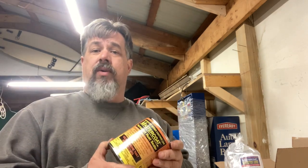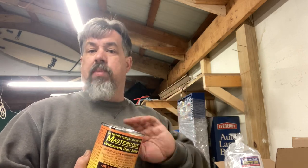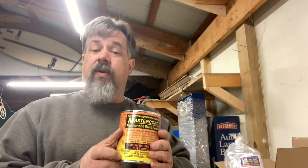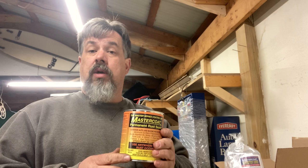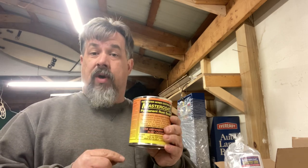This product is for rusty metal — after you've done a repair, this is a great product to stop rust. A lot of guys use POR-15, but this stuff blows that out of the water. POR-15 does not have any UV protection, so if you put POR-15 on and leave it outside it'll get chalky in six months and it's no good. This has UV in it. They make a black and a couple other colors, but the silver is where it's at — whatever is in the pigment of the silver will lock rust down.